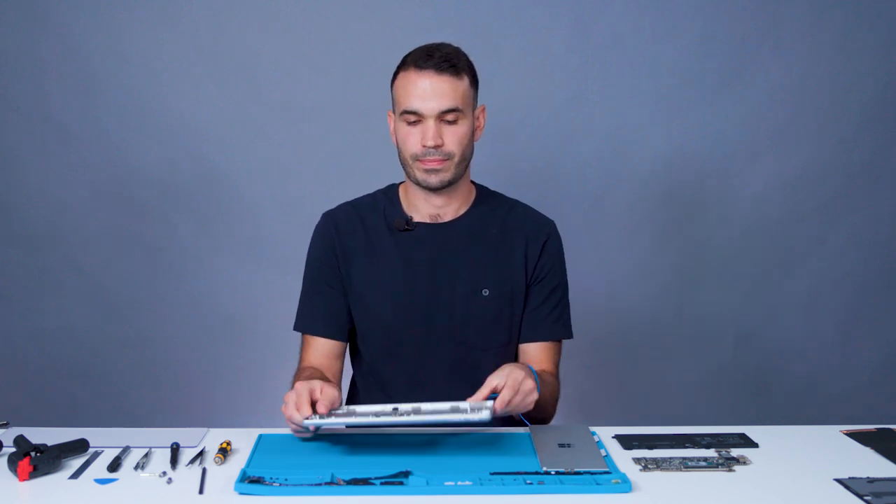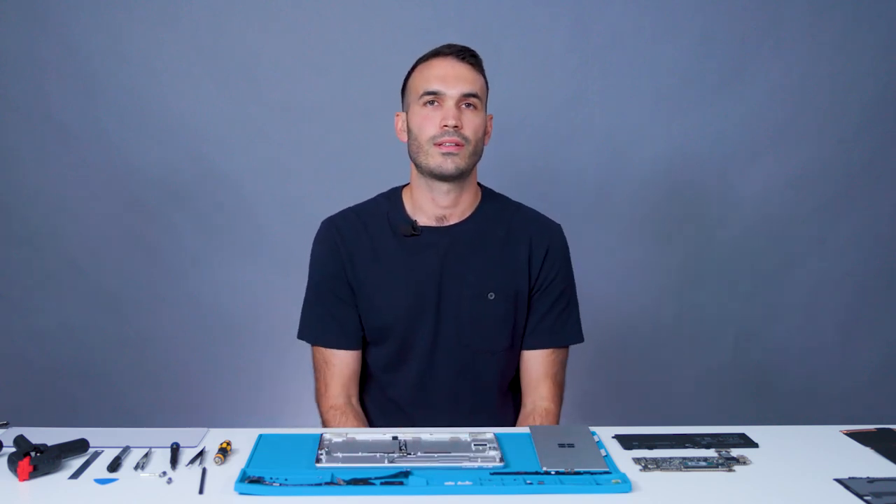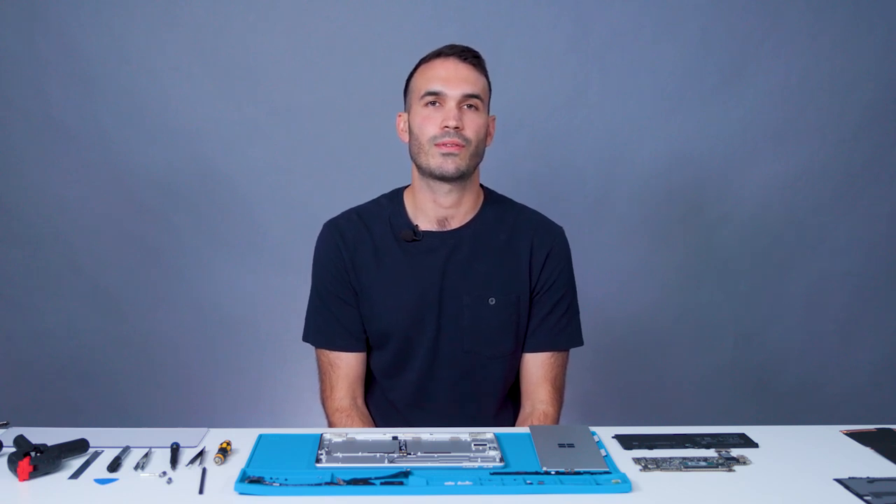With this, we've completed the disassembly of the device. A few things to note: during reassembly, make sure there aren't any screws or foreign objects inside the device, especially near the magnets or the battery region. After finishing, remember to attach the SSD and connect it to a power supply to get it to power on. I hope you found this video useful. Check the Microsoft site for more information or to learn about Microsoft sustainability efforts.